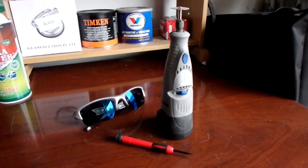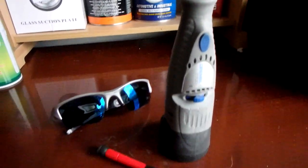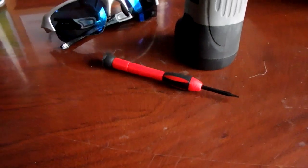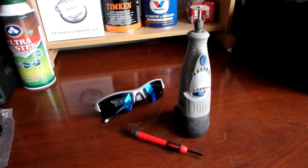For this little project to get that stud out, we're gonna need three things: just a Dremel with a nice little cutting edge on there, a short thin flat head screwdriver, and of course some safety goggles — any kind you have. All I have are some Oakleys, so we'll use those. Get in there and be safe.